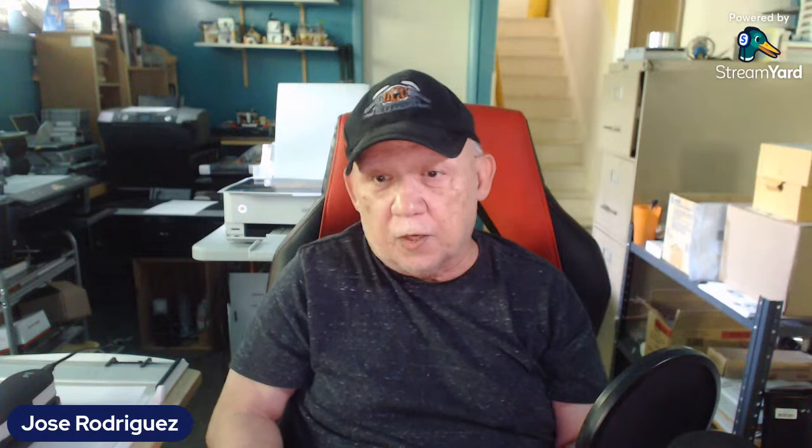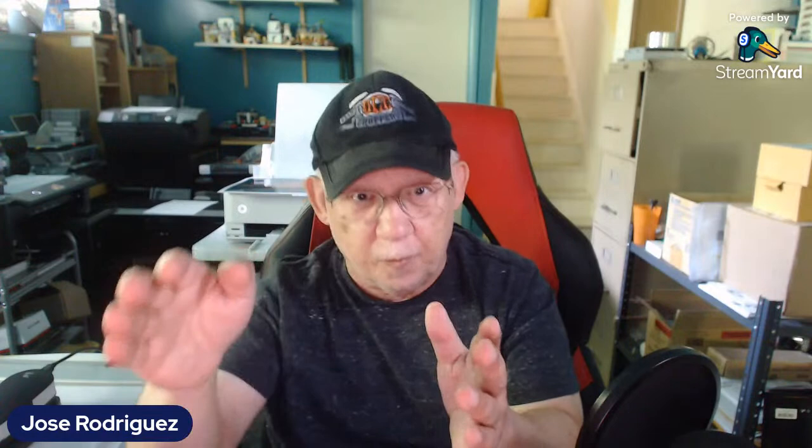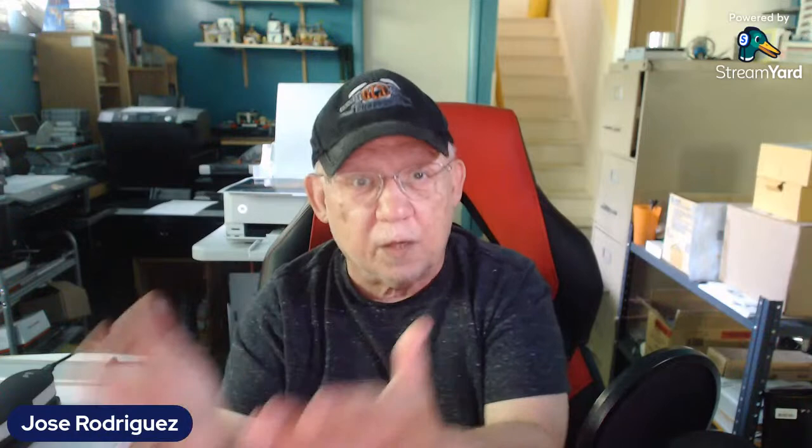Now, let's talk about Epson. Since they were accusing Epson, we're going to talk about good old Epson printers. So we're talking about any printer that does not have a stationary cartridge. And that's still too broad of a classification, because there are printers that have cartridges that move with the printhead that have user replaceable cartridges for waste ink. Those cartridges, they reach a certain point, just like the pads.